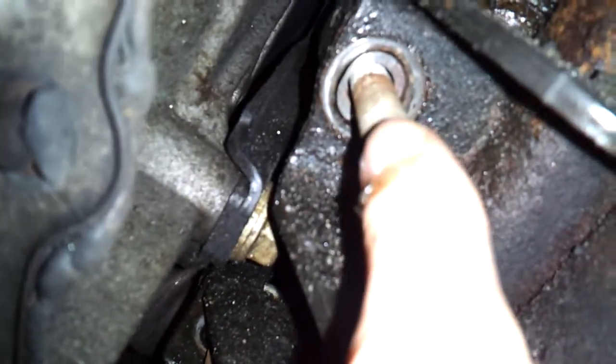So that's what the factory FE2 20 mil bushing looks like. And then at that point I wasn't able to move the bar up and down like this, so I had to get some room. The first thing I dropped was the rear tranny mount. So 15 there, a 15 nut on that stud and another 15 nut on that stud. Drop that down, and then I took these two 15 rear brace supports off, and that actually started bringing the subframe down slowly.